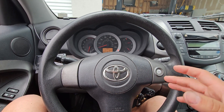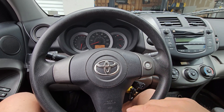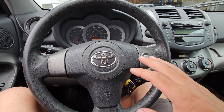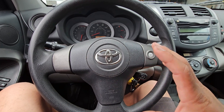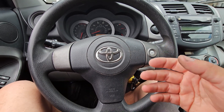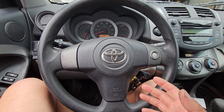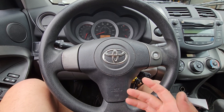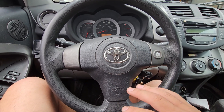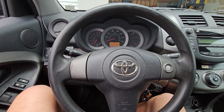I'm going to skip that warm-up process. The time when you start the idle relearn is when the fans kick on on the actual car. Now if you have a truck with a fan clutch, you won't be able to know that until you reach operating temperature, so if needed, drive around the block for about 10-15 minutes until you reach operating temperature.